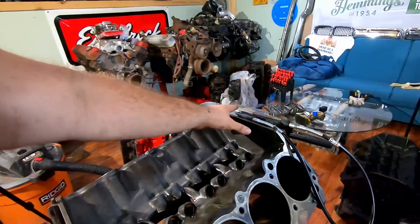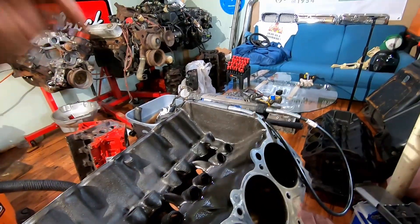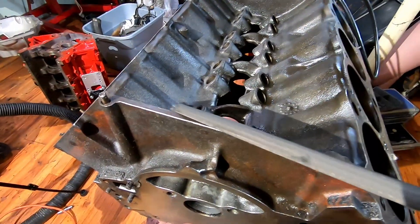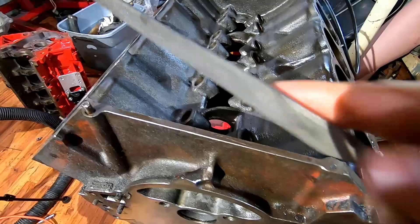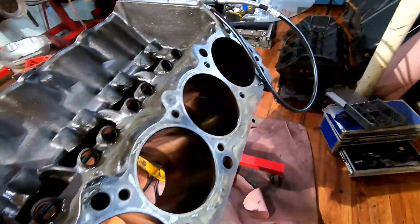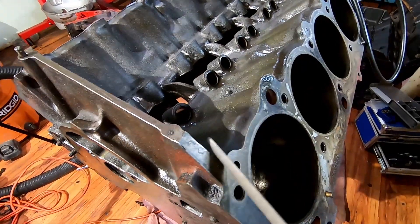You can do a couple of methods. I prefer the Dremel — taking small bites opposed to giant bites. It takes longer but is far more precise. For nice long sections, grab a file and run it along, watching for anything you don't want to hit. Then you can use the bastard side of it on the inside. Smaller ones work really well to get nice fine bites out of it.